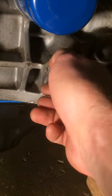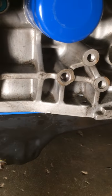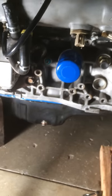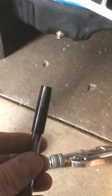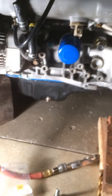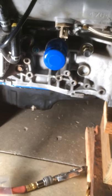Now we have gone ahead and repaired that bolt hole. Look — it's like butter in there now. That's Mr. Cho's thread repair on aluminum. Like I said, you definitely want to take your time with these or you will screw them up — I screwed one up last night. Just take your time. Finesse. Run that tap in multiple times in and out, make sure it's clean and ready to go. And there you have it — you've repaired that stripped hole from a strong arm. You can put your bolt back in there, torque it back to spec, and you're worry-free. Thank you again for tuning into Mr. Cho's Garage — we'll just keep sending you stuff as we work on stuff. That's how we get down. Thank you.